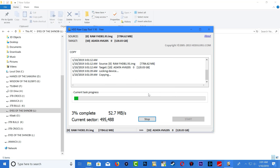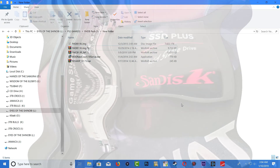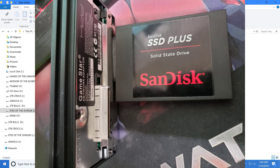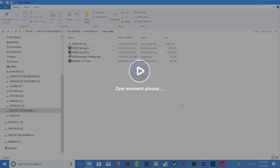This will take some time, so come back once it's done. Once complete, you'll see 'Task Complete' and '100% complete' at the bottom. Close the program. Now unplug the PS2 hard drive from the PC, connect it to the PS2 network SATA adapter, and plug it into your PS2.